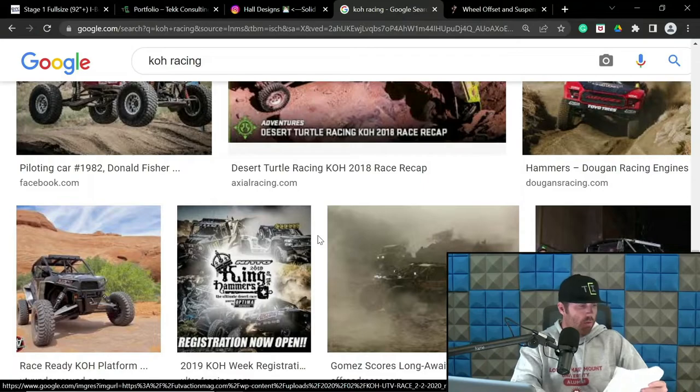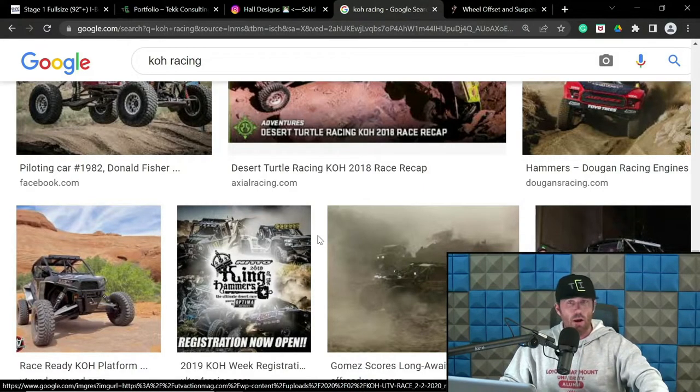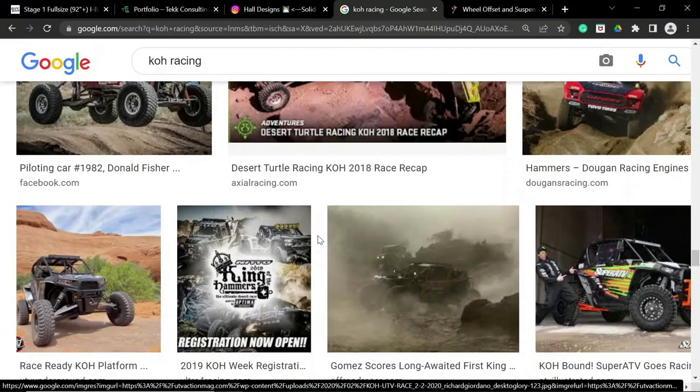Now, when it comes to sand car buggies, etc., I, to some degree, do prefer, I don't know, I've done them a few different ways. So some of the guys who've designed sand car buggy stuff, they kind of go super mellow with it to where there's like barely any camber gain at compression, and they keep it basically flat at extension. Again, if you've got positive camber at any point in time in a buggy, that's pretty much wrong. There's no reason to have it in sand car shit. There just really isn't.